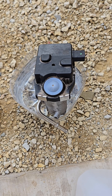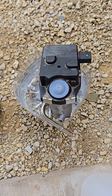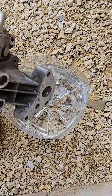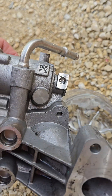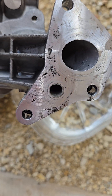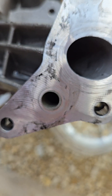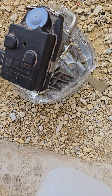So as I said: two gallons of purple power, one gallon of distilled vinegar, and two gallons of distilled water to rinse it out. Something else nobody mentions — an important point: if you soak and just use purple power, it's just going to get sticky again. My suggestion is to pour some distilled vinegar in there and then distilled water, because the cooler has been soaking in purple power and that gets into the coolant line. It will be contaminated if you do not use distilled vinegar to neutralize the purple power.